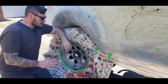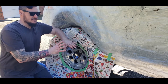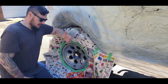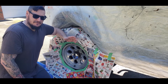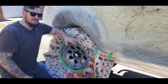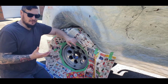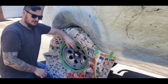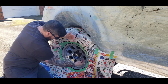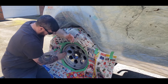Alright guys, we're moving along nicely here. As you can see, I washed the wheels really good, let them dry — I went for a walk with the family — and now we're back and I've got everything prepped. Prep is huge. This is about the sixth time I've done this, on my own vehicles or a friend's. There are holes or slats in every single rim and paint's going to fly through there onto your suspension and brake components, so grab a bag or newspaper and wrap around the inside of the wheel from behind. If you can get it to not touch the rim, you don't have to worry about pulling any paint off afterwards.